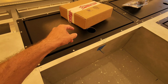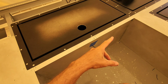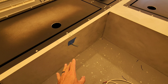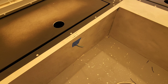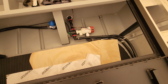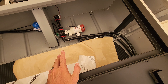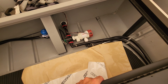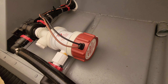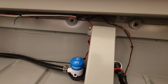Your money is really in the backing, which is why I go with the ones with 3M backing. This boat will also get small spotlight LEDs in the cockpit, but we need to get the turf in first. I already have the leads pre-run because before you do foam, board insulation, or cockpit walls, you've got to have your leads ran. This is actually a cooler and there was no way to get wiring back through once everything was pour-foamed. In the wiring process you may need to think ahead and pre-run leads.